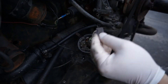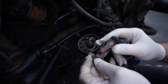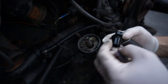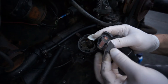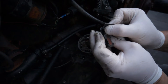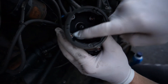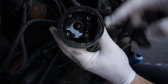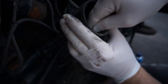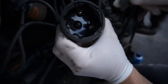I put the emery cloth down between those two pads and pulled it up and down — just enough to rough up the points pad area where we get that spark. I did it about seven times. Then I took the rotor button and cleaned the tip where it gets spark. I also cleaned up inside the distributor cap connections — as the rotor button spins around, current goes up through those wires, so we want a better spark coming out of those points.